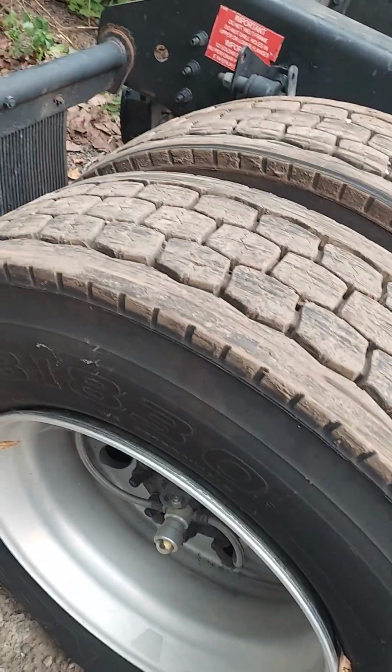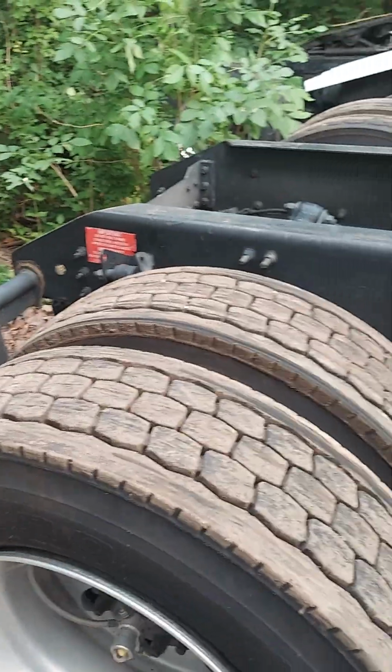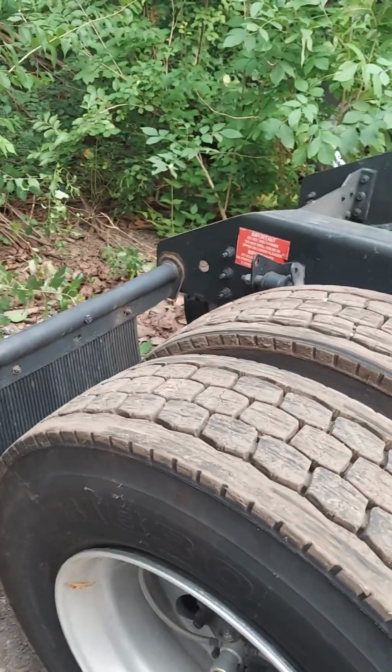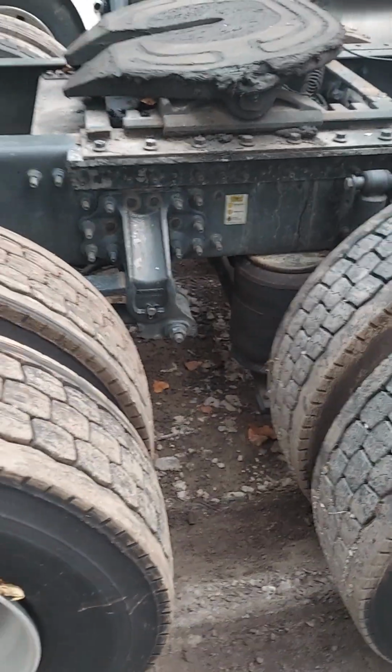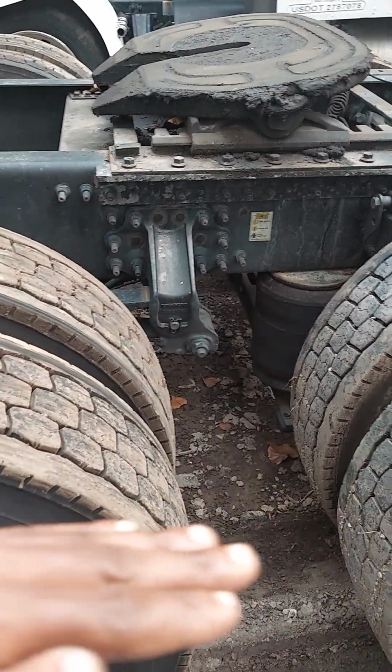I think it's this one. I'm not so sure. But even when I was driving a Western Express lease truck, up in the Nashville terminal, I had backed into a spot similar to this. It had a mound behind it, and I couldn't move the truck at all. So I put it on differentials. It still couldn't move. It was a gravel surface with tons of rocks, so that gravel kind of sloped down and came up. So what I had to do is rock the truck. I had to put it in reverse, then forward, reverse, then forward, and then slide it out. And it came out from getting stuck.